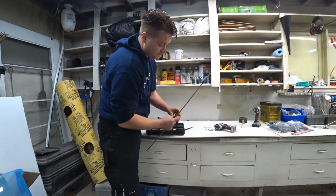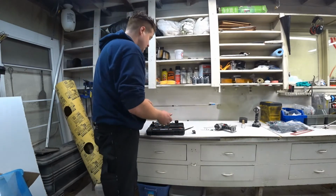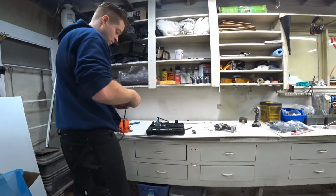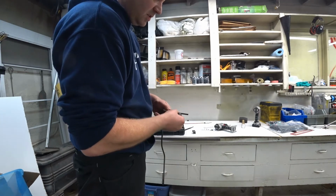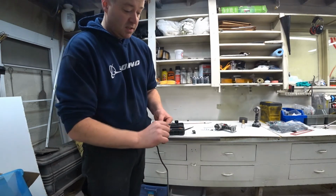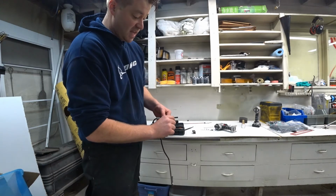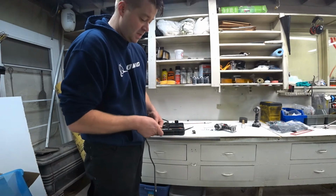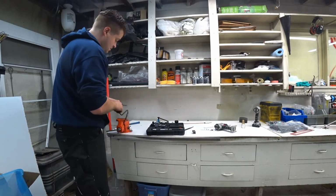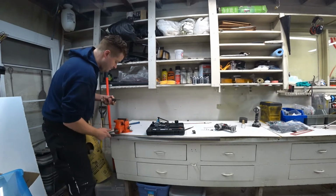It comes with these little blocks for different size tubes, and I need to find the blocks for the 1/4" tube that I'm using. So this one says 1/4, that should be it. And I know that when I go to flare this line, I need the nut to be on here at the time. So I can't make my cut any shorter. I can't cut this tube any shorter than right there, because that's where this tube actually needs to flare. And I should read the instructions. I probably have to leave at least a 1/2 inch on this thing. So I'm going to slide this up here, put this guy together, and stick him in the vise. Way too far there.